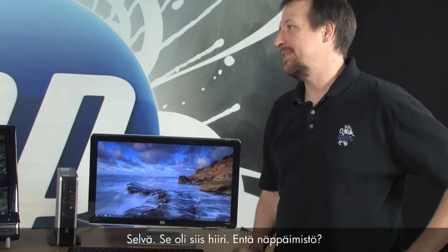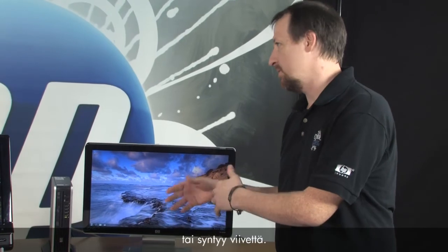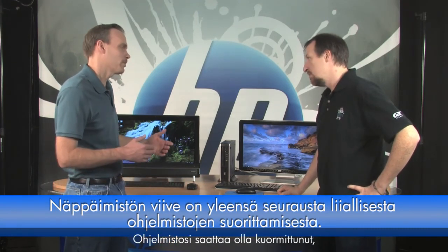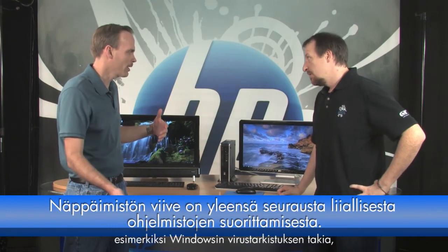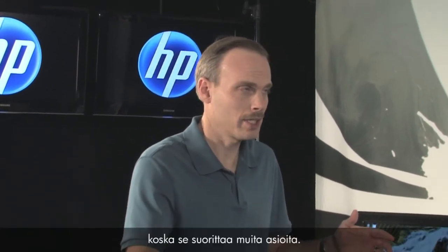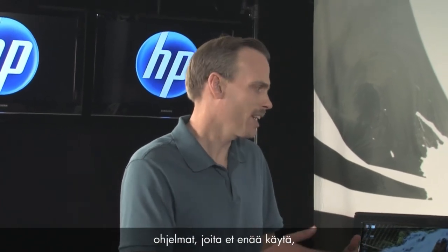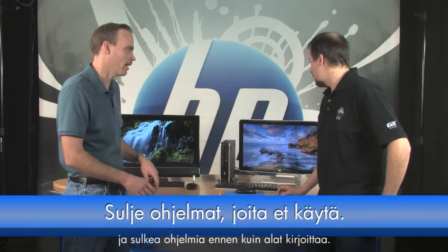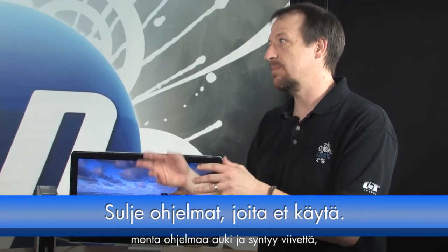So that's the mouse, but what if it's the keyboard? Sometimes when you're typing it skips letters or there's a lag. Keyboard lag is typically caused by software — if your software is under heavy load, like Windows running a virus scan in the background, the system is too busy to display what you're typing on screen. The best thing you can do is uninstall software you don't use, prevent software from loading with Windows, and close everything down before you work on typing.